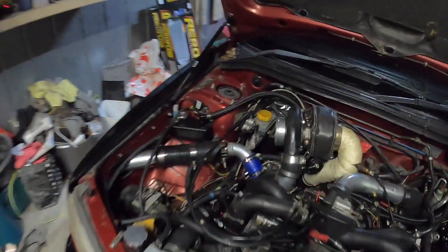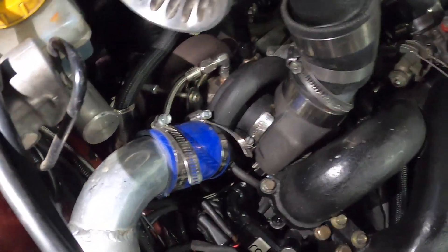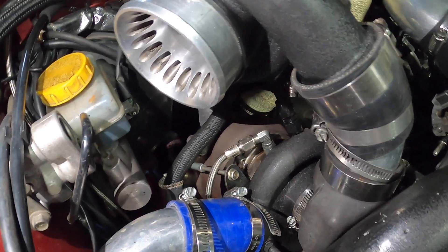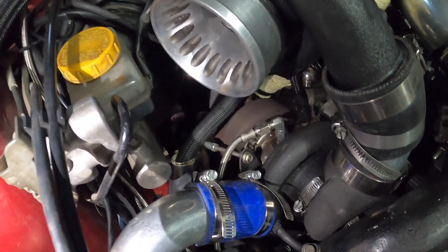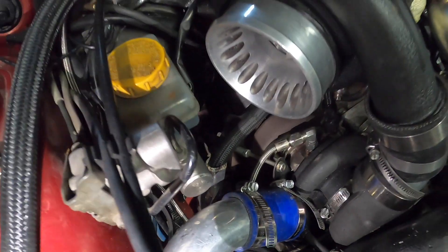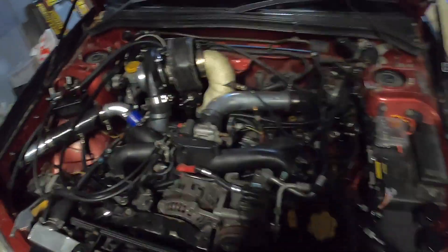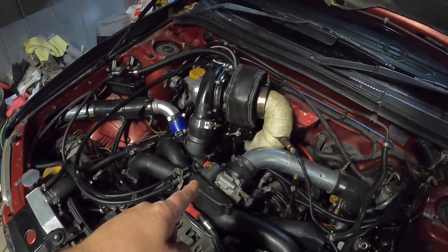What I'm going to do is try to get the oil feed off and swap it around so I've got the banjo on the top, because I've got a banjo with the restrictor. So I might be able to do that. And yeah, when that's all off I'll seal around the back there - hopefully that'll get rid of this smoking issue, because it was actually getting pretty bad when I was out there. Luckily it was dark.